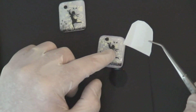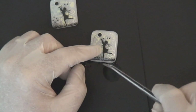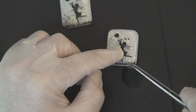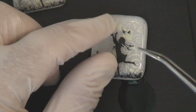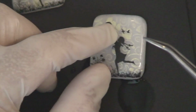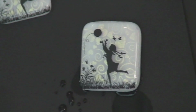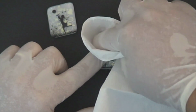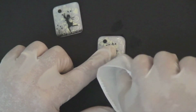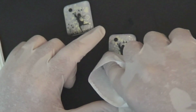See how easy that is to move around like that? So I like to bend some of the stuff around the glass to give it a little character and depth. So I'm going to bring this glass way down like that. Now that looks like it's in pretty good shape. It's centered well. So what I do then is I hold it in place, and then from center to out, I'll squeegee and hold it on the sides to wick the water out from underneath it.